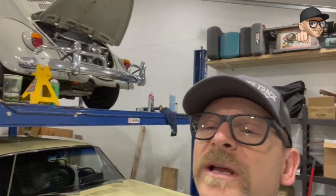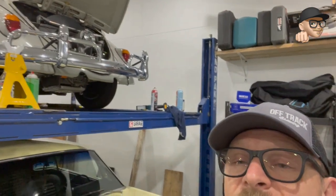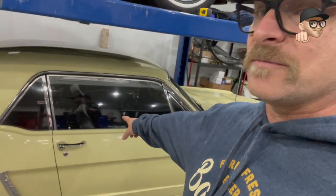The back bumper is on and it looks great. Bill did a great job restoring it — it had a bunch of pits and some spider webbing in the chrome, but it looks really good now. Both these cars are '65s and they both have little tiny bolts holding the bumpers on. On the beetle I believe those are M8s, 20 millimeters long — thinner than a pencil and about the length of a quarter. So there are four of them — that's your crash protection, 1965.